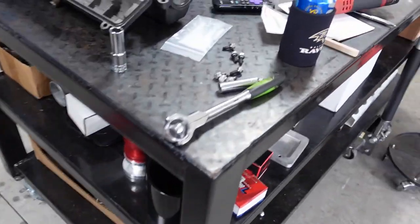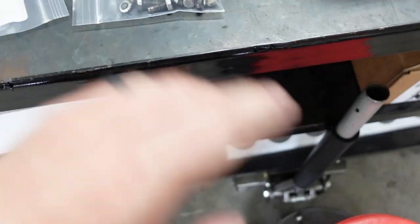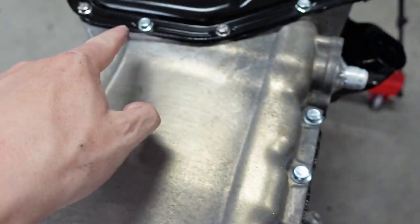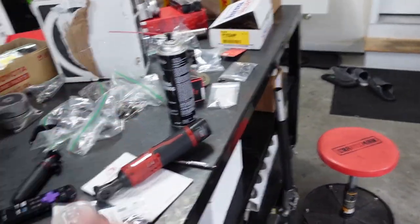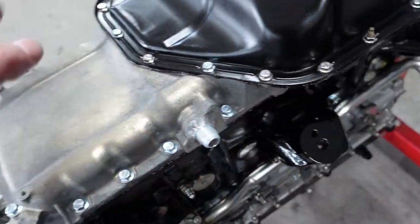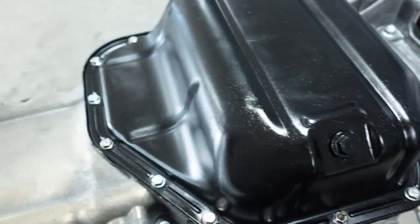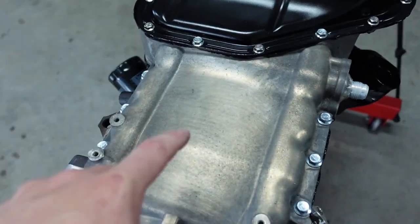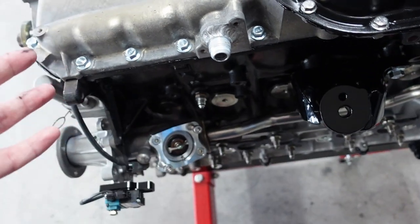That seemed like a bit of a cluster. The new bolts I bought were apparently too long — they were bottoming out in the blind holes. I used shorter stainless steel bolts instead and there's plenty of thread, so it should be fine. This pan is just spray-painted by the way — it was cleaned up, sanded, used a brass brush, and chrome/aluminum cleaner. Got it pretty good. I'm happy with how it looks.